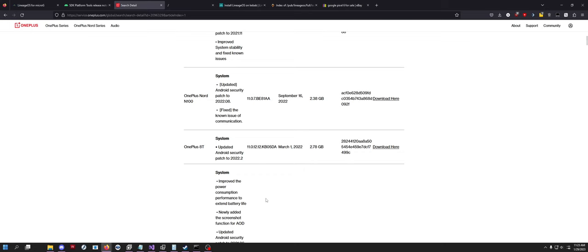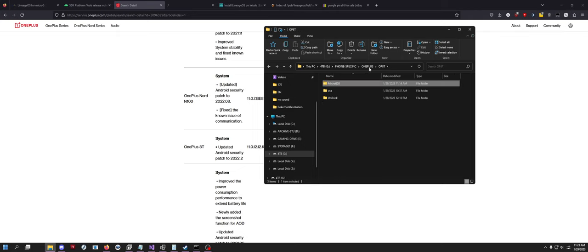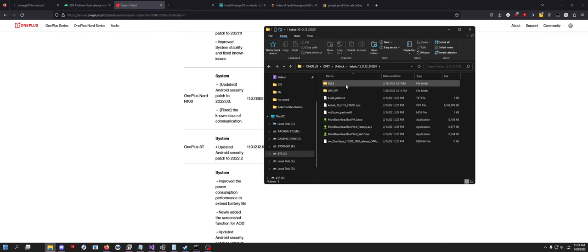My device is not currently turned on. It's in bootloader mode because I was in the middle of doing this, and then I went, this is a good video idea. And if you want to really start from scratch, obviously make sure yours is the KB2005. Go to XDA and get the Unbrick for Android 11 for the KB2005 and flash this in the Firehose mode. You just run this as admin, click start, turn your phone off, hold volume up, volume down, and plug it into the computer, and it'll immediately start flashing it back to factory settings.